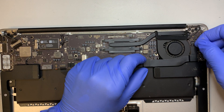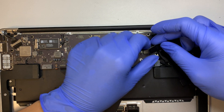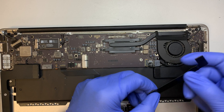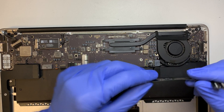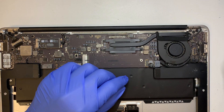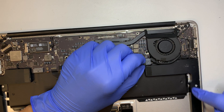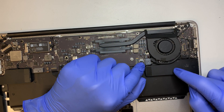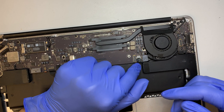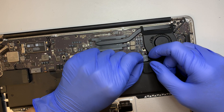Let's move on. I'll disconnect this cable and this cable here. Lift it up like a Lego — you can see there's a slight double-sided tape — twist it around and that's how you disconnect this cable. Here is your speaker. We are not going to touch the speaker. And this is the webcam — your LCD screen camera. To work on this, slide it down, meaning slide it towards yourself.